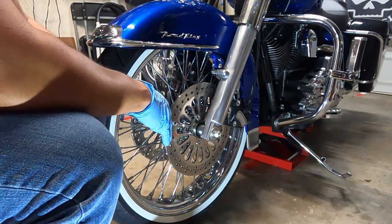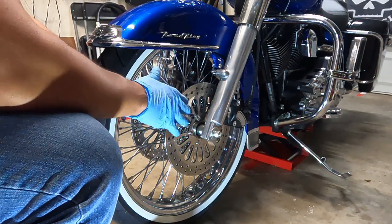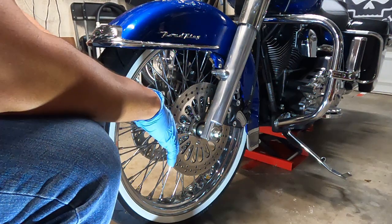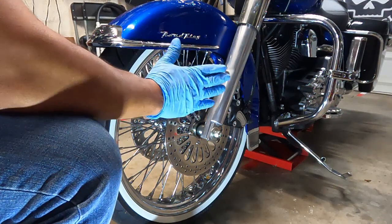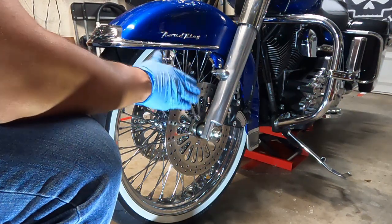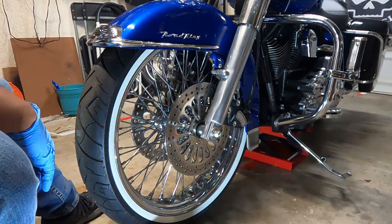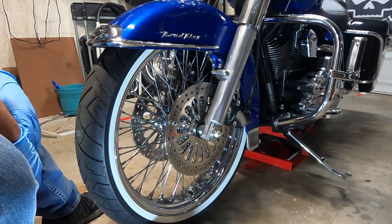All I have to do is push the axle back to the other side, remove that spacer, and put a little bit of axle grease on the new one — you want things nice and greased up — then put it all back together. It's a very simple fix to a very annoying issue. If you don't fix it and you wedge your brake caliper in place, you're going to end up with rubbing brake pads that you're constantly chasing. And even if you're not chasing it, that little bit of pressure means your rotor is going to be pushing against a pad and you'll have uneven wear on your brake pad. That's why we're addressing it this way.